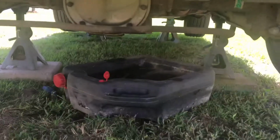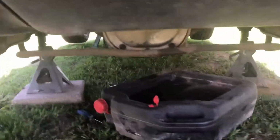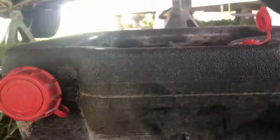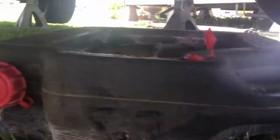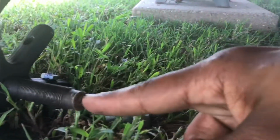Anyways, while I was taking off the seal, what happened? I think I left off by about to pull the flange. Well, I pulled the flange with this little puller right here. Man, mosquitoes are under here. Oh my god. Never seen this before. Well, it's not that I never seen it pulled, I just never seen it at my house. Well, it was over here, so I just used it. So I pulled it off of that, you know, grab the flange, put this in the middle of your pinion, and it pulls right off.